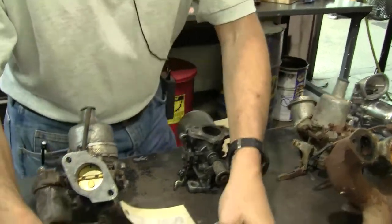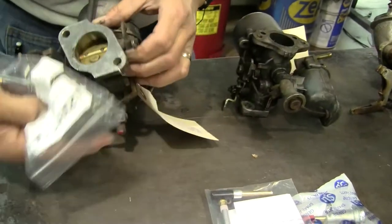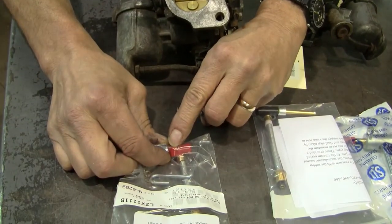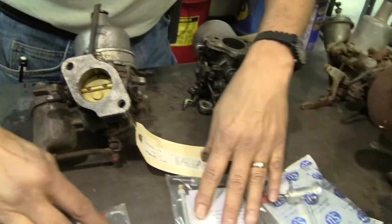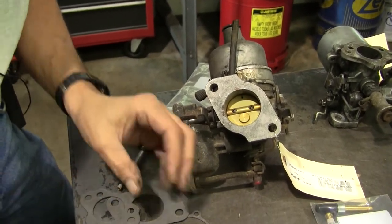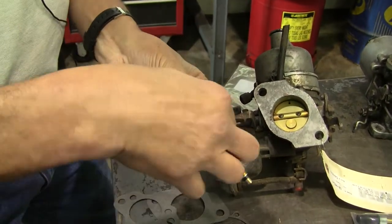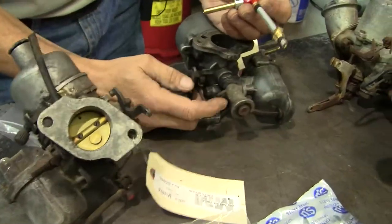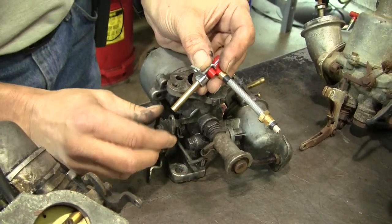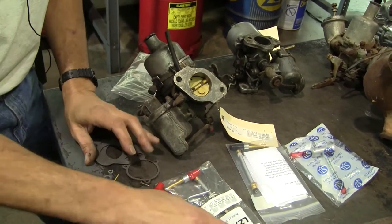When you call in asking which kit or carburetor you need, the main thing to check is the bottom of the carb: you'll either have a red or black jet tube assembly, or a wax stat. You can buy the wax stat separately or in a kit. A conversion I like to do is take the later wax stat style and convert it to the earlier fixed style, which many people prefer because it's more consistent and doesn't give you the variances the wax stat can. This kit — the LZX 1111A — uses a bracket and the same arm and coupling from the wax stat linkage, so it's a clever and actually cheaper conversion.